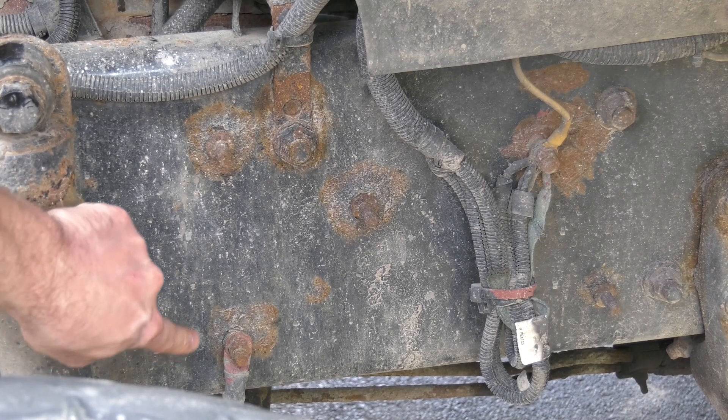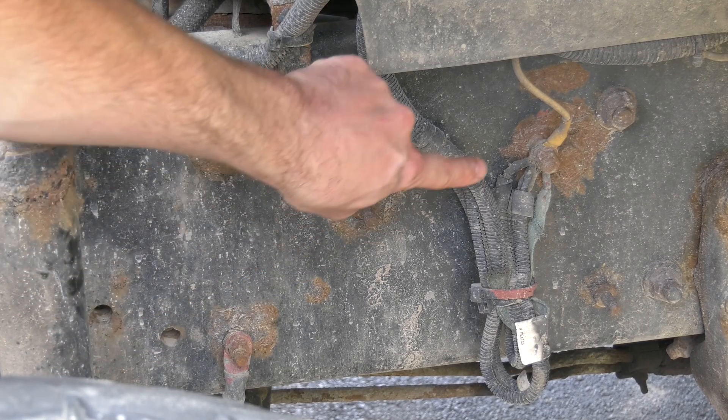As you can see from our test results, we had excessive voltage drop on the positive side and excessive voltage drop on the negative side of the circuit. You can see through our visual inspection that the negative cable going to the frame was excessively corroded and should be attended to. This should help with the voltage drop problem in the system.